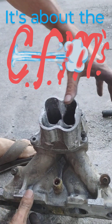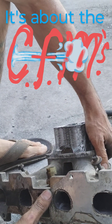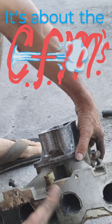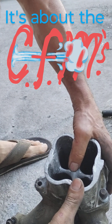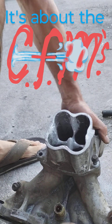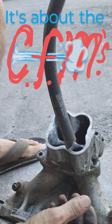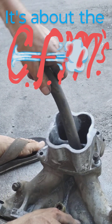Here's how you test this. You've got four different ports there. Before I gasket match — that's an important part of this — you want to get evenness. I haven't messed with the head yet, but here's what you do. Watch this. To check the continuity and evenness of the ports, I'm going to snake this through.